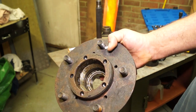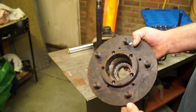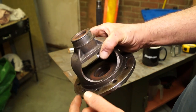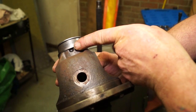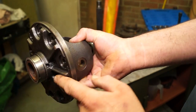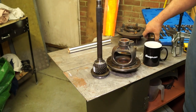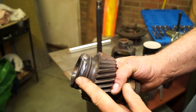I do a lot of trailer hubs and the bearing race is inside — not on this one because they're easy to punch out — but I usually weld them out and then just tap them out, drop another race in, very quick and easy. Now this is a diff carrier. I've taken the rollers off so we have this bearing left on here. You have two tags here which you could pull the races off, however we don't have that specialist tool. You can see the pegs here; you possibly could weld around it and then chisel it off — that's an option, especially since weld heats things up.